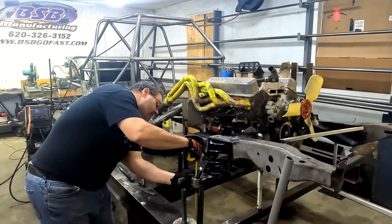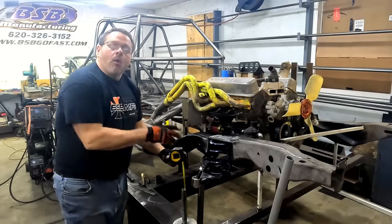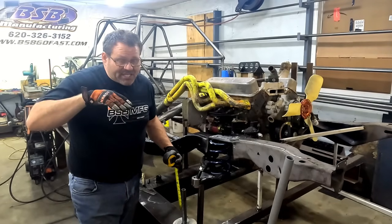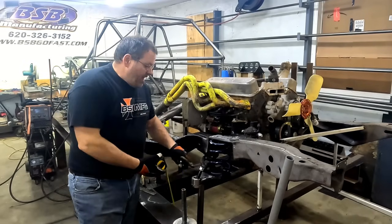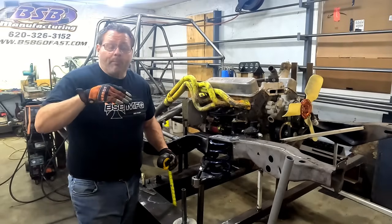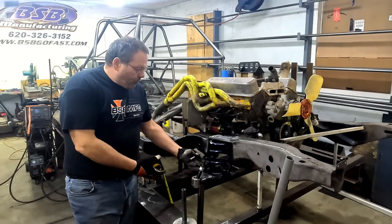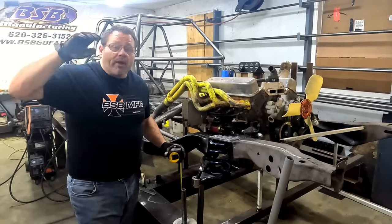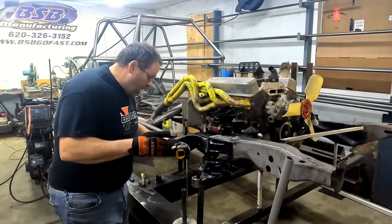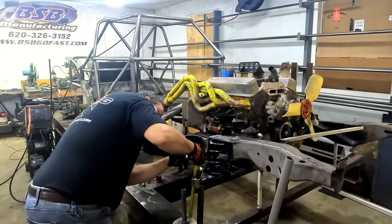For that reason, here's what I'm fixing to do: I'm going to make a mark where the shock would mount and put two inches of compression right here from ride height. Why two inches? I suspect I'm probably going to pull a half inch of static ride height, and when running the car through a corner compressing, that half inch is going to turn into two inches — maybe pulling down another inch and a half, up to two or two and a half through bumps. On average, two inches compressed from level is a good point to represent where the spring is most commonly working.